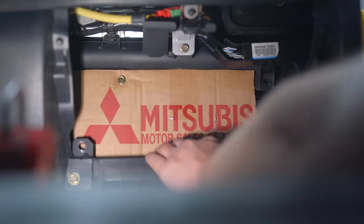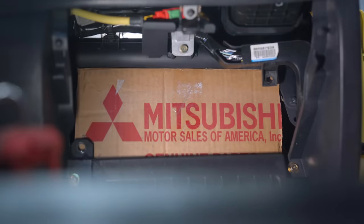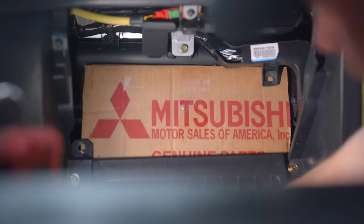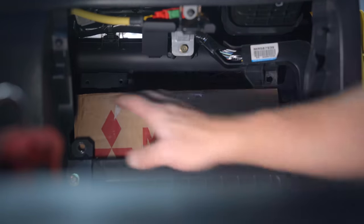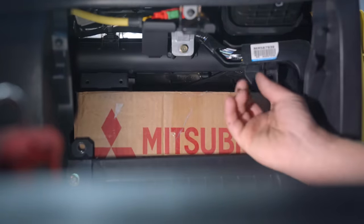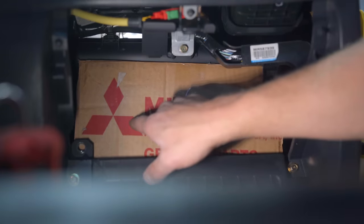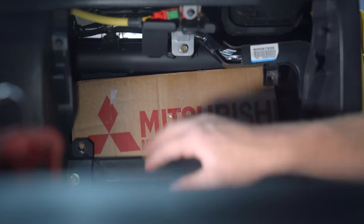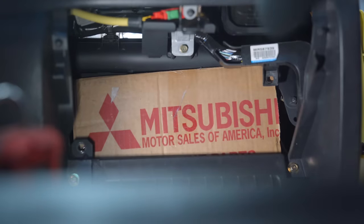Okay, it's not going to be quite enough space. We're going to have to rethink. Okay, I'm on to something here. We're going to have to do a little bit of trimming right here, just because the Elite 2500 is quite lengthy. But I should be able to use those two mounts up there, that mount there for this wiring harness. And if it's a little rattly, I can easily put a riv nut into this guy and use that mount there as well. But I do want a space here for the wiring to pass through.